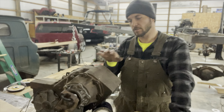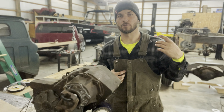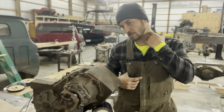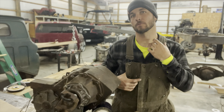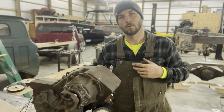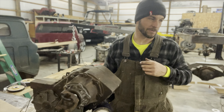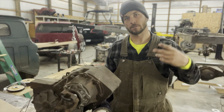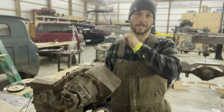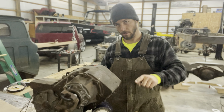To actually mount this in the frame of the truck — I've pretty much finished up the rear truss and all the brackets for it, so I'm kind of waiting on parts. My four-link arms are going to be two-inch DOM tubing with one-and-a-quarter-inch Heim joints, I believe. Once all that gets here we'll get the arms together, set the truss, weld it to the axle, and get all that sorted.